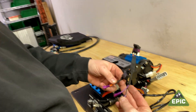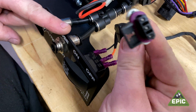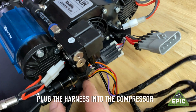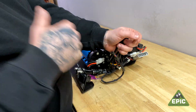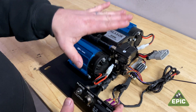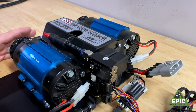We're going to connect the new connector. You have the color diagram, so we're going to go black, orange, purple — that's how that looks. Then you're going to take this connector and plug it back into the A or B compressor connector we had before. This wire will all get cleaned up and tidied when installed in the vehicle. This is a fully assembled Kraken system with the pressure control upgrade kit, ready to be put in the vehicle for assembly.